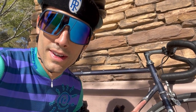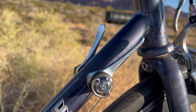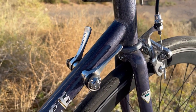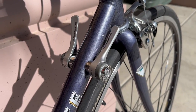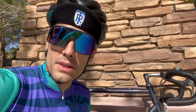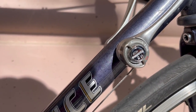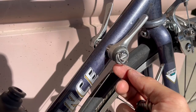Best part — it's got friction mode. I found out that the other Dura-Ace down tube shifters I did a video on also have friction mode, even though the manual never said so and there's no clear indication. The D-ring was so stiff I thought I was going to break it. But the Shimano 600 clearly indicates friction mode. I'm going to switch it over now to show you the difference — it's in index mode right now.